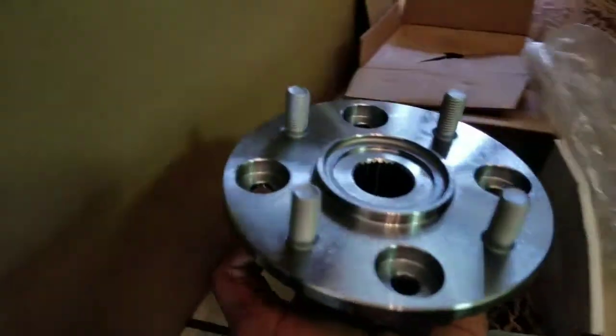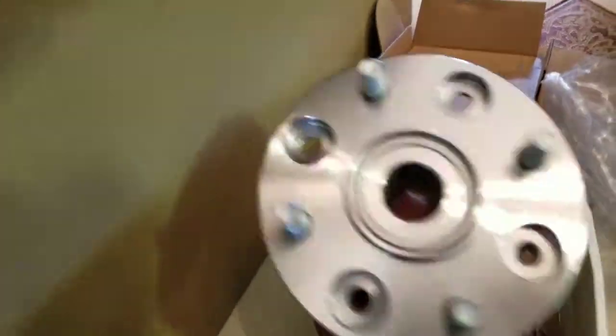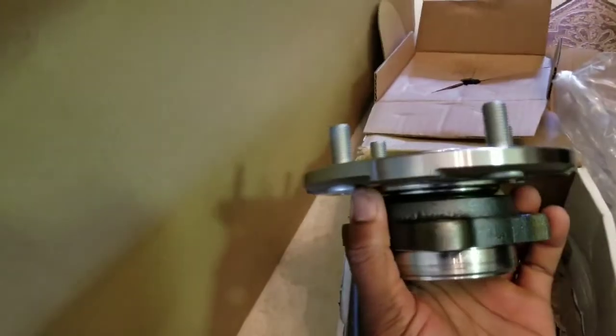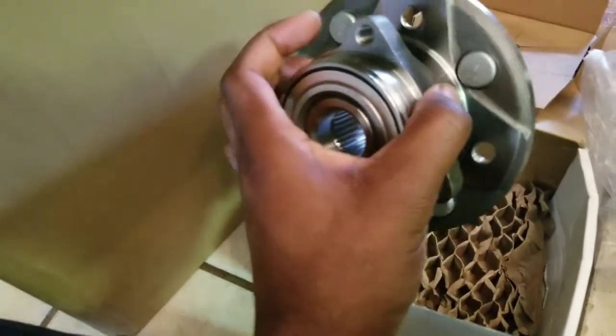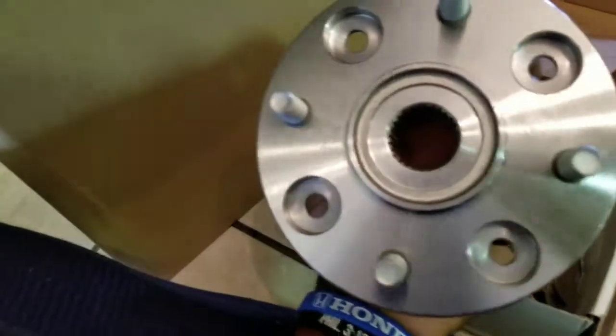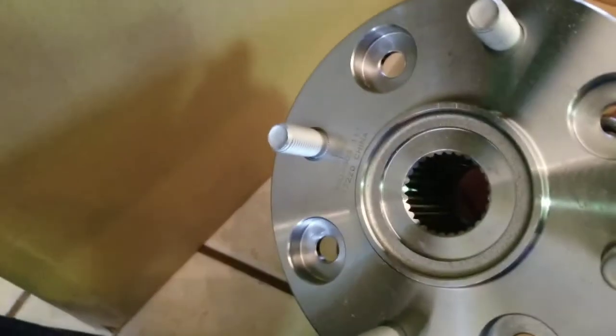Next box — I have no idea what this is, only cut the box open, haven't ripped it open yet. These must be — yes, these are the hubs. Here is the hub assembly — the whole thing. I bought it pre-pressed because I don't have a press yet, which I am going to get. These are from an Acura CL, which has the same spline as the Accord axle, so it'll just slip right in there.